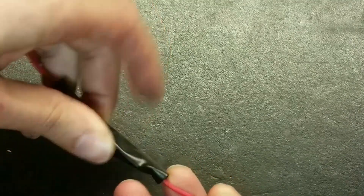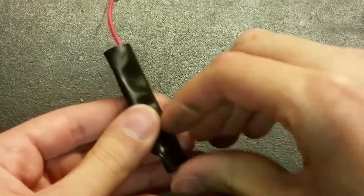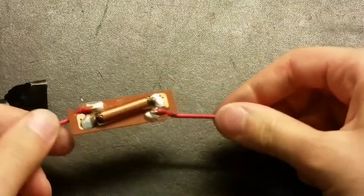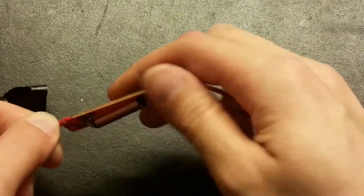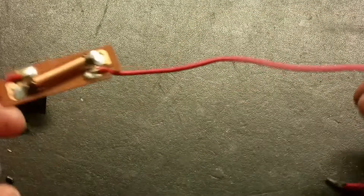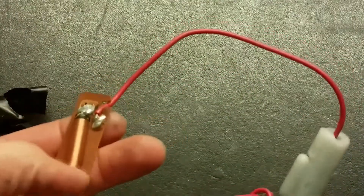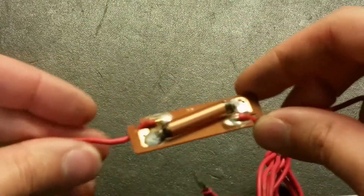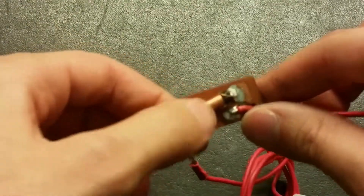There's some kind of micro switch in there. Let's take it apart. Here's the inside of it - it's an inductor. So this will filter the input power. If there are a lot of harmonics when you have the ignition coil or the alternator and everything, it just gives out random frequencies you don't want in your car radio, so you have a little inductor here that helps with that.